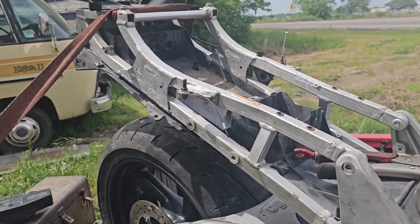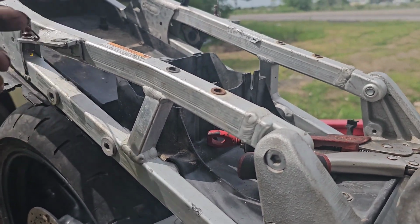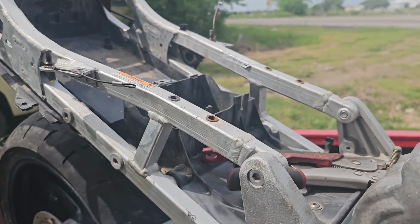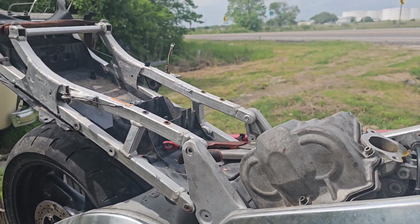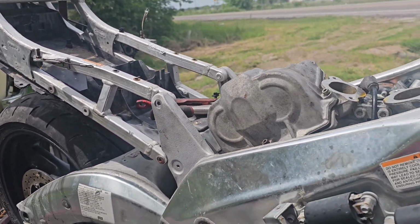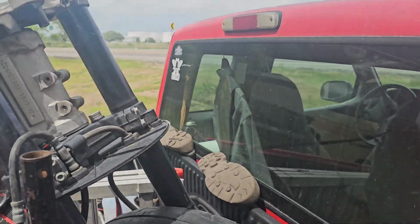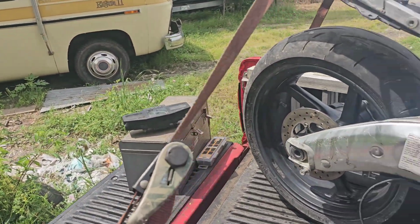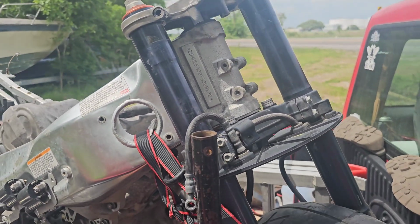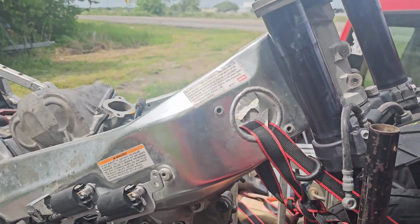Those are actually the seat mount pegs, and there's a cotter pin that's supposed to go on that little guy, and it clicks into there to hold the seat in place in the rear. I thought they were just bolts that held it down, but this one actually has both of the seat pins. But yeah, I got the front stay bracket off and clocks off the stay bracket. Stay bracket was a little bent up, but I got it kind of straightened up. I'm going to need to do a little bit of aluminum soldering on it.